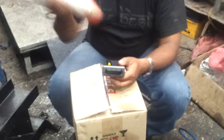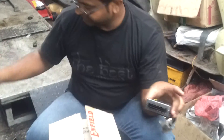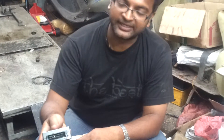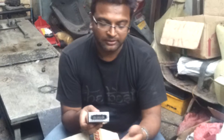After the lacquer coat dries, you have to use silicone spray grease. This is a non-conductive grease, so it will not harm again. This is to avoid moisture inside — water will not enter inside. After lacquer coat, I will be spraying the grease. That's it, I am done. If any liquid remains inside, just leave it or tip it off. Nothing is going to harm since it's a non-conductive grease. You are done with the coating of the ECU connector.